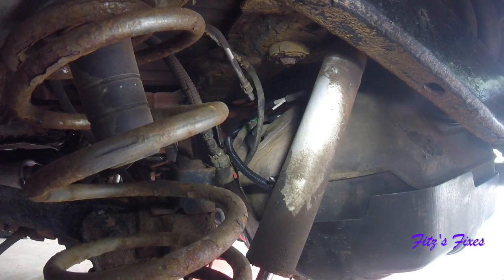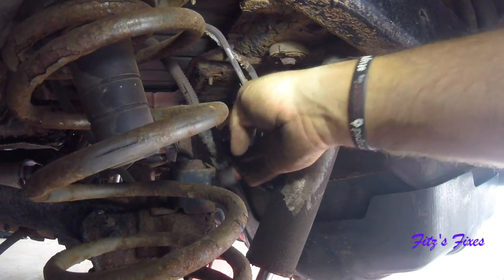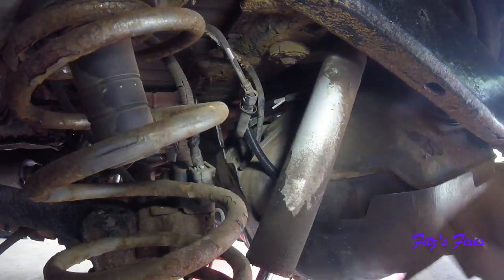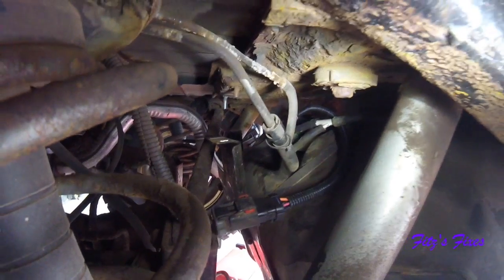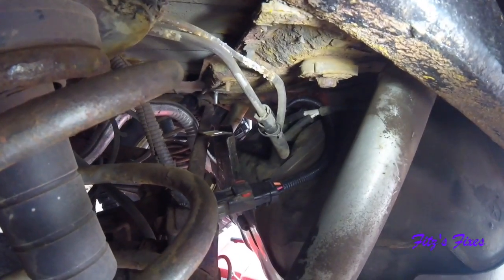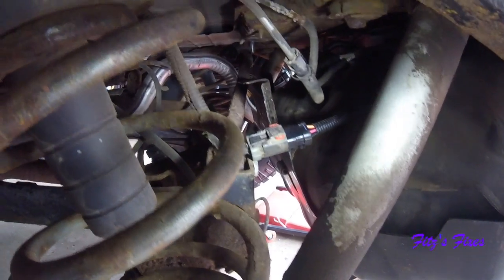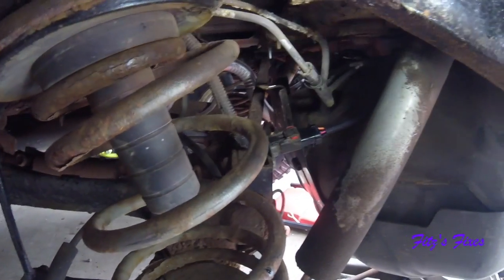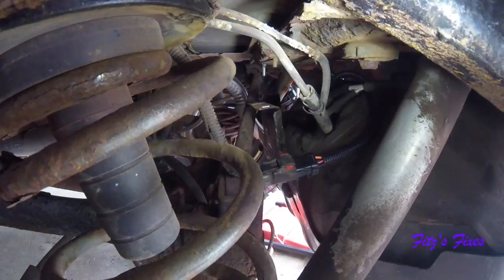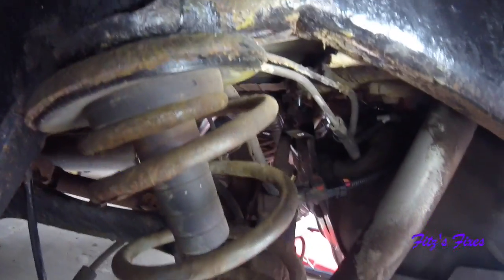I strongly advise doing this job when there's no fuel in the tank. I've got about two gallons in there - it's not heavy but it makes it awkward because it sloshes around and wants to tip. The skid plate is pretty heavy on its own. I just got it sitting on a jack - not perfectly safe, but I'm not under it. So now I'm going to hook up these fuel lines and the electrical wire while the tank is still down, and put that breather back on. The fuel line just clips in and that wire just pops on - then remember to push that red tab back through.